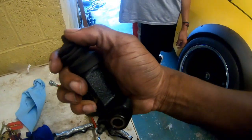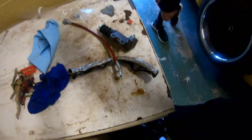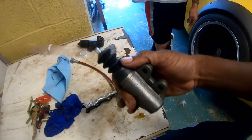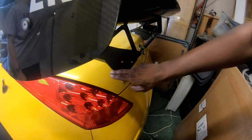That one time we got it in was a lot of work and we're very sweaty now, so we're going to get food. Haven't had lunch yet and I didn't even have breakfast. We'll come back, insulate that line, and install everything. Here's the old slave cylinder — it doesn't really look bad at first, but actually this is pretty terrible. Notice how it stayed compressed like that. That's not good. Thank god we're replacing it. One quick tip: wrap a zip tie around the boot to make sure it never comes loose. While we're out we'll grab more clutch fluid.